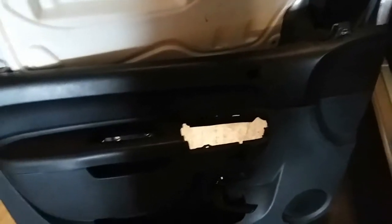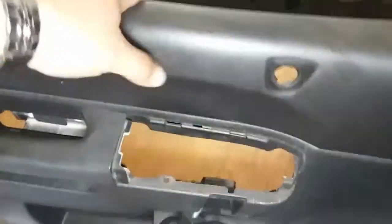We have the door handle up in here that we have to loosen up. This door handle is broken — that is the reason why we're removing this. We'll go ahead and undo this. Here is the piece that we have to loosen up, so we'll use the needle nose to get that loose. Once you pinch that out, it should come out. There is another sensor plugged in right here — just push that out, and out comes the door.